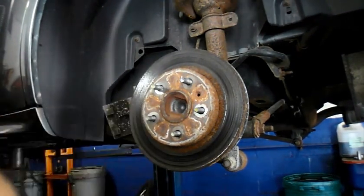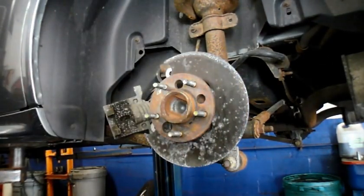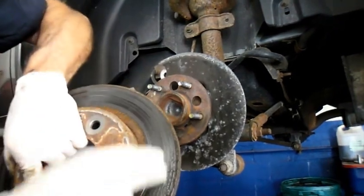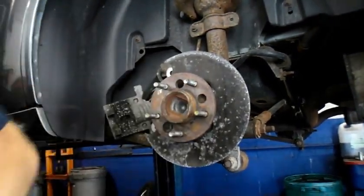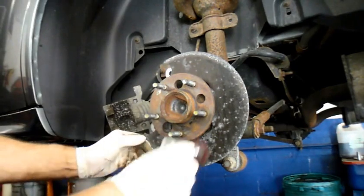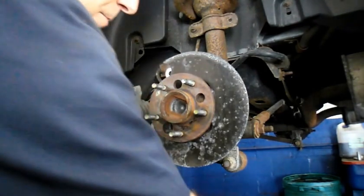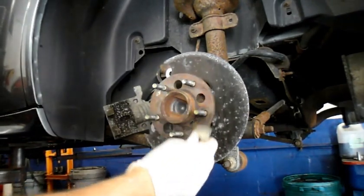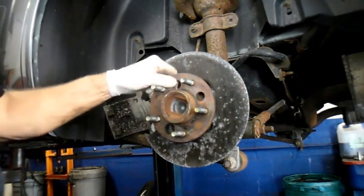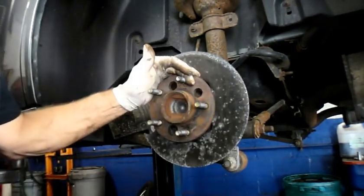It's actually supposed to slide right off, but that's how rusty it is. Take your rotor off the car. I just want to point this out — the back of the rotor is just as bad as the front of the rotor. That's why it doesn't really pay to even machine this rotor — it's beyond machining. Next thing we're going to do is come in here with our wire wheel and clean this up right here. You can use a disc, a razor, sandpaper, or a scraper — whatever you have at your disposal. Just make sure that all that rust comes off there, otherwise you're going to have a pulsating pedal.